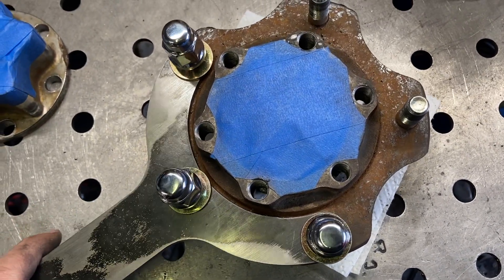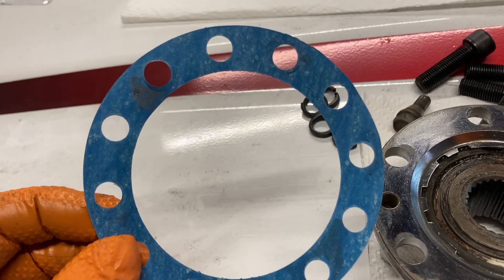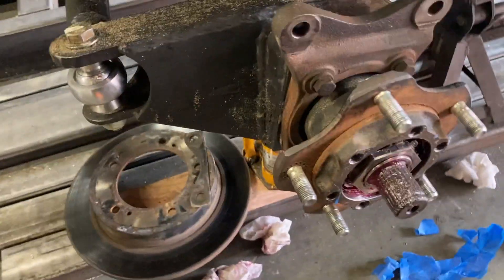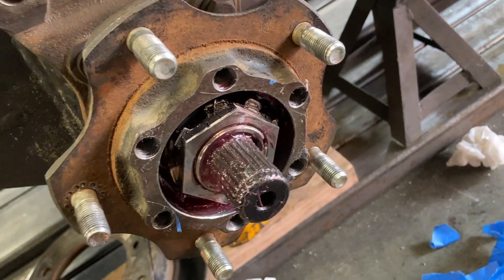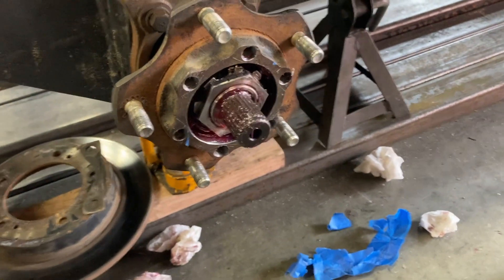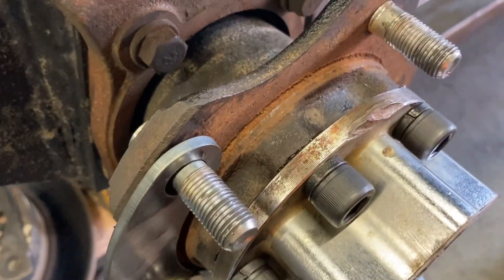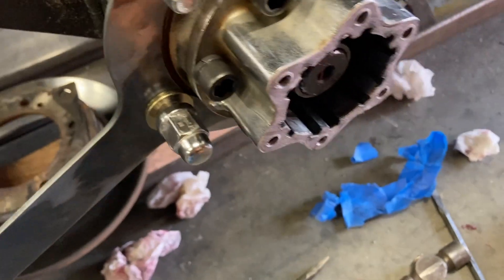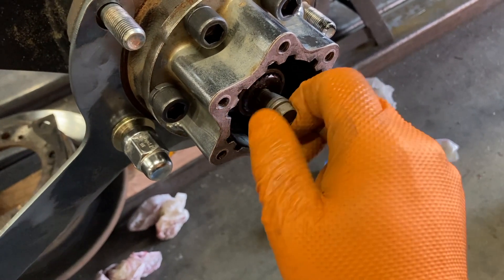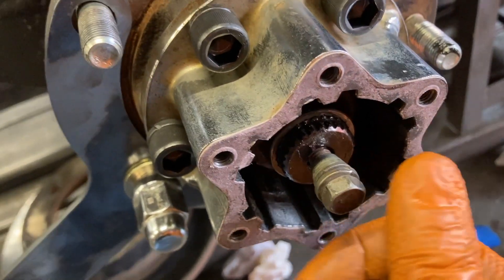One difference in putting it back together: the gasket has holes meant for the little stock bolts, so I don't use the gasket. I just use a little bit of gasket maker - put it on the face of the hub, a real thin coat, brake clean it real clean first on both sides, and then torque the bolts down. Here's the hub body installed with all the bolts loctited and torqued. I would keep one of your old bolts around because it's helpful for getting that snap ring in there and pulling the axle out.